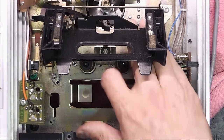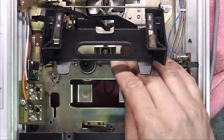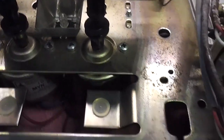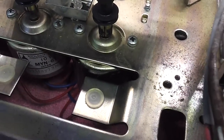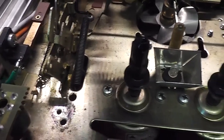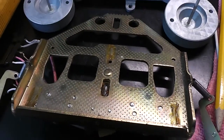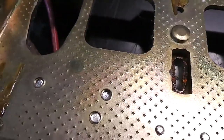I need to turn my attention to this synchronous motor and its lubrication, same for these reel motors. Just a quick close-up view of the deck stripped down. May 1973 on the spool motors. A little quick clean of the deck to get some of this grease off. You can see where the grease has been running - that's where the three ball bearings are, and there's another point here with grease residue as well.